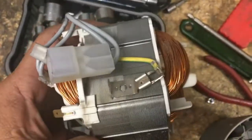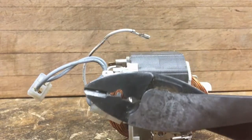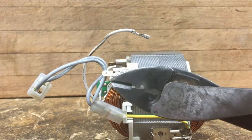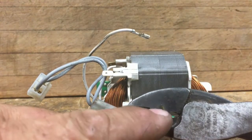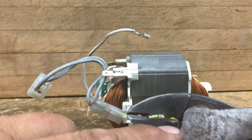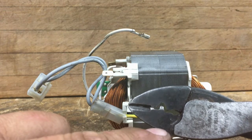That's a good design but it's got a couple of flaws and that's definitely one of them. This is what you're going to want — a really good crimper. You don't want those cheap crimpers, the ones you usually buy at the automotive store or Ace Hardware. They do have these, but these are where the better tools are at and they crimp a lot better. They've got this little notch for up to 12 gauge, and anything over 12 you go down here.